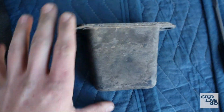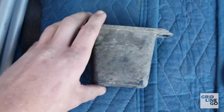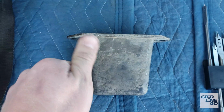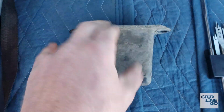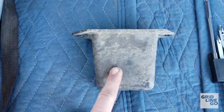So this is my bump stop, the bump stop alone, and this is just too short for my flex because the tire will still go up and hit the fender and touch just a little bit. It's not locking like it was. I had some blown out ones that are progressive, but these ones are solid mount from the first gen Rodeo, like I was talking about.